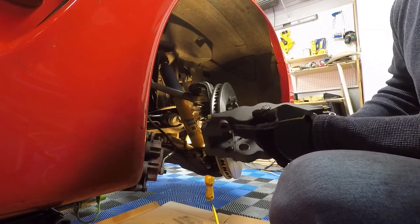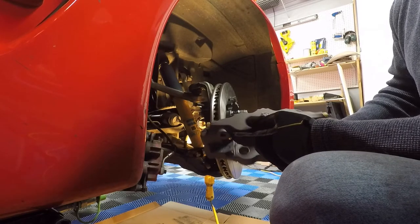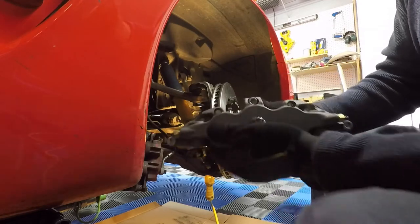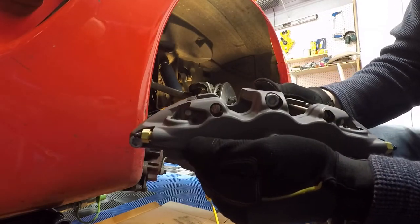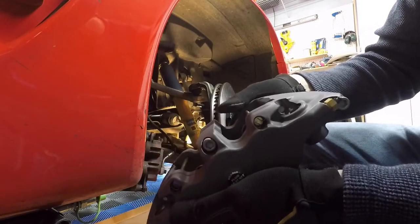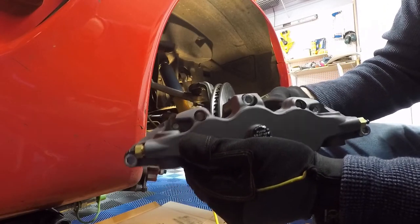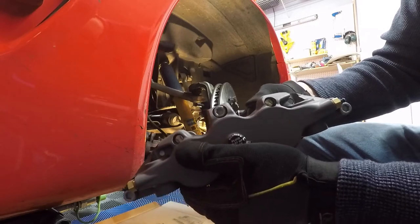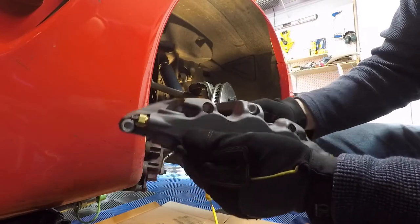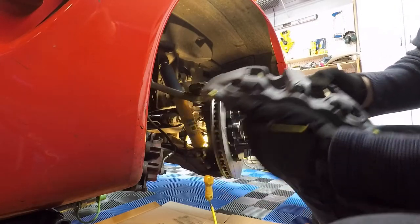Okay, I'm gonna go ahead and get the brake pads in here, get these pins out. I don't know if you can see that, but these little spring-loaded clips in here. Not the best way to do that, I don't think, but there it is. We're gonna go ahead and get those out, get the brake pads in, get these pieces back. We're gonna oil them up with some 3-in-1 oil, just a little bit. Get them nice and smooth to get them sliding in and out of here. And then we'll put these guys on here and see how the fit goes. All right, we'll be right back.